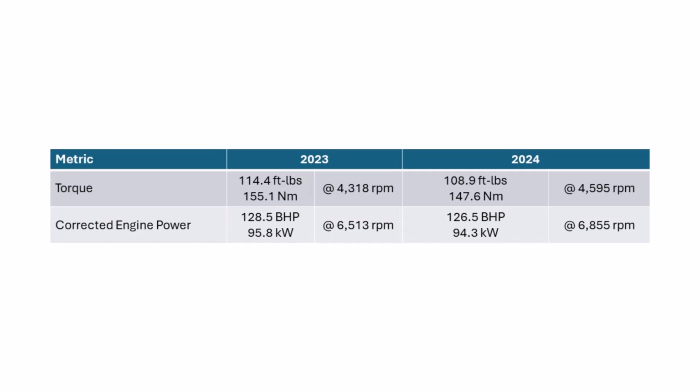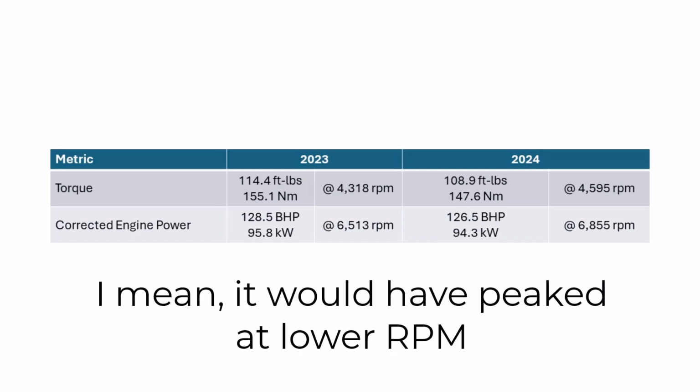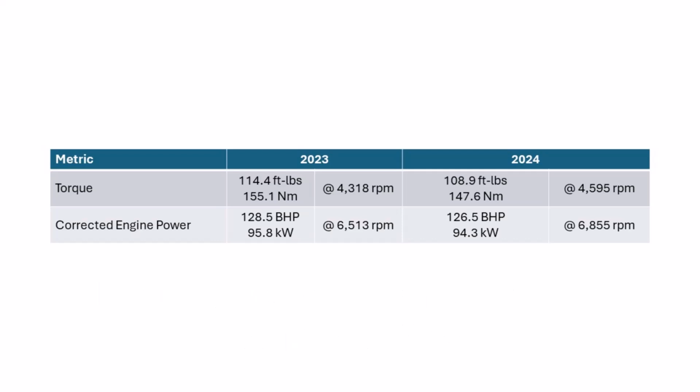The valves are shutting tight. I checked them for leak down. They were fine. Could be that I've slightly tweaked the cam timing. Maybe I've advanced it a bit, but you would have thought that the torque figure would have moved downwards rather than upwards. So yeah, I'm not too concerned, quite honestly. We're really playing at the margins here, and my driving ability is a bigger factor than the power from the engine. But it does look as though the engine's in good health.